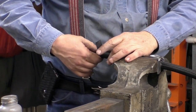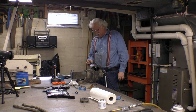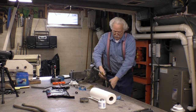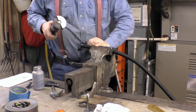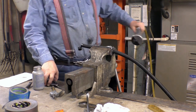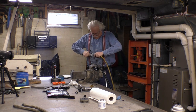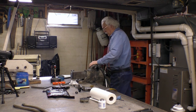There are a bunch of ways to cut this hose and they even make a special cutter. A hacksaw is not the way to go, and you've got to remember there's steel inside the hose so you can't just cut it with a knife. I found the best way is to use a cutoff wheel — you get a nice straight cut. Resist the urge to rip the tape off because again you will fray the end and that makes it very difficult to get the nut on, so take scissors and cut it off for a nice clean end. This is an oil filter line so blow it out with an air hose.